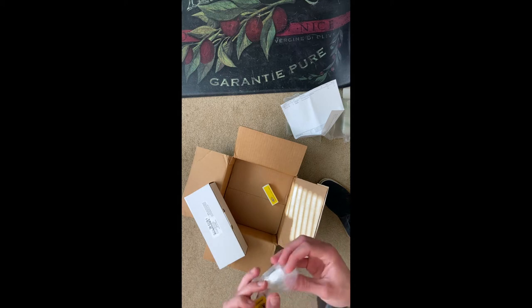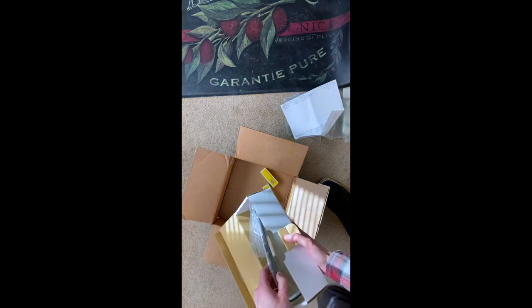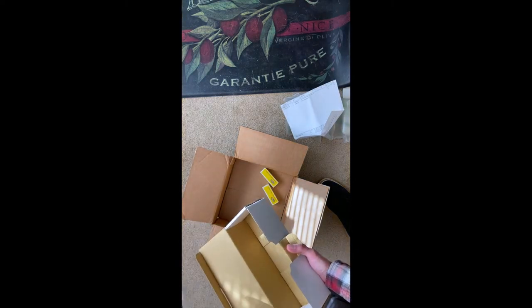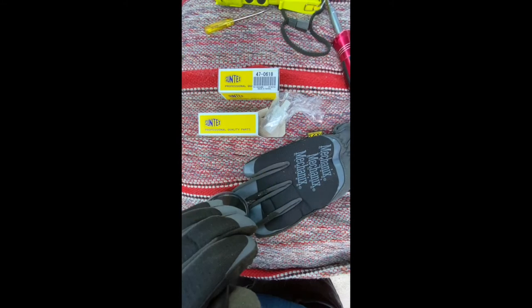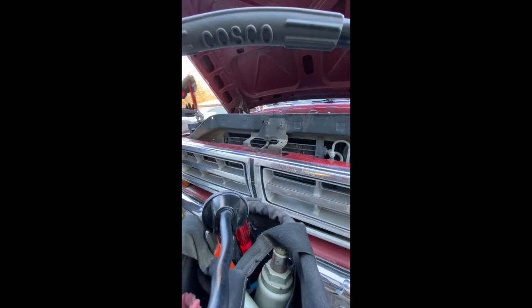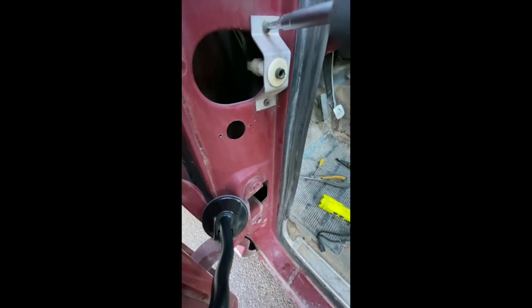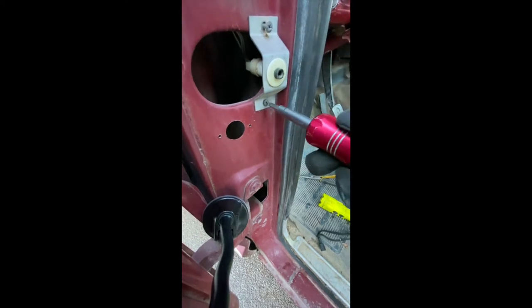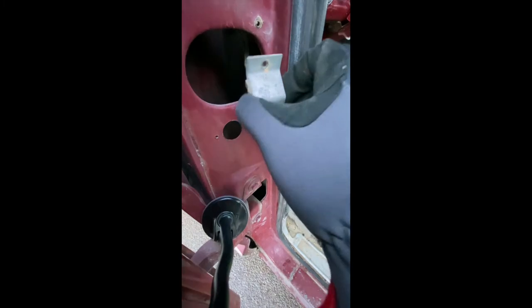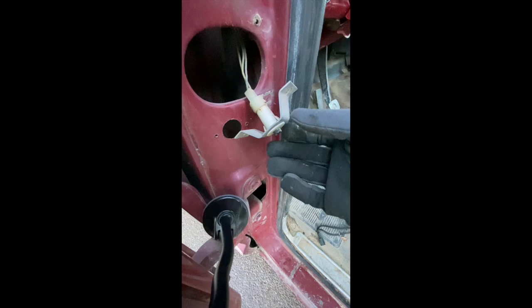I also got a new rear view mirror that I'll add to the pickup later. I'm going to add the part number in the description below. I didn't want to break the fuse, so just disconnect the battery cables before starting to work here. When you take things off, do take note of the switch connection orientation — that's quite important, as you'll see in a minute.